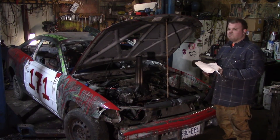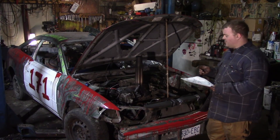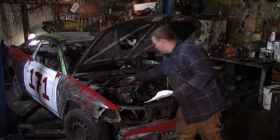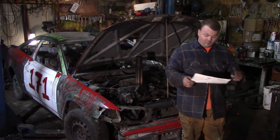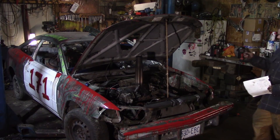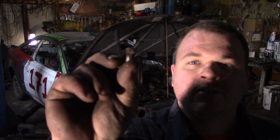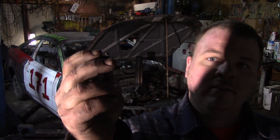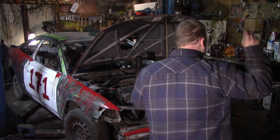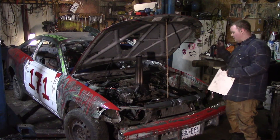Fluids I haven't checked yet. Door padding — I tied it back to the door. Motor mounts I have not done yet, but I didn't want to do it while the body was up — I'll do that now or tomorrow. One other thing I'm going to do is get rid of the rear brakes. I have two welded-off caps — it's a brake fitting I've cut and welded solid on top so no hydraulic fluid escapes. I'm going to use these to delete the rear brakes: cut the lines, put a 10mm on there, break the existing lines off, and thread those caps in.